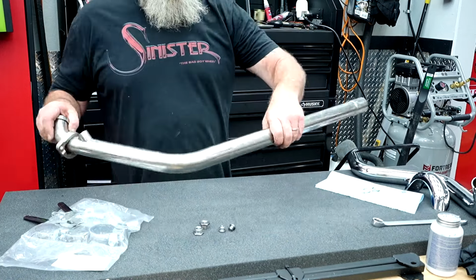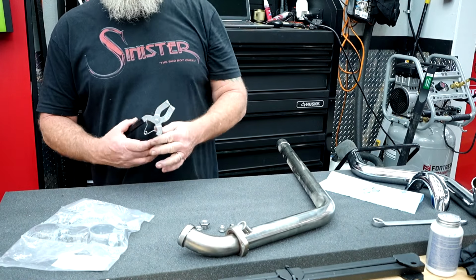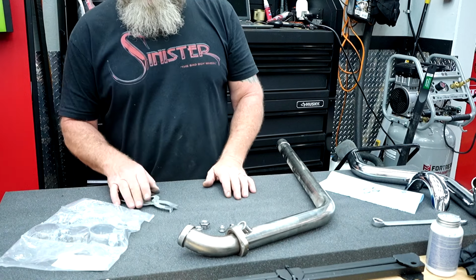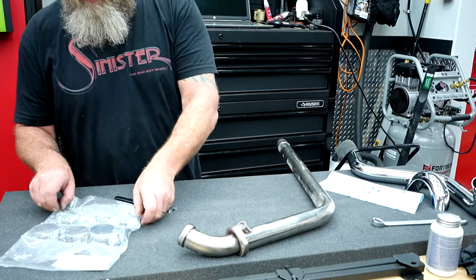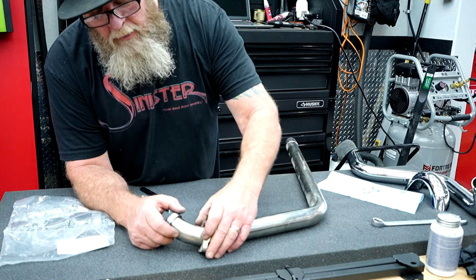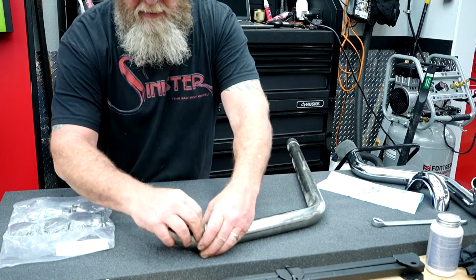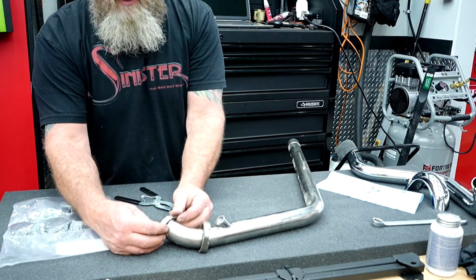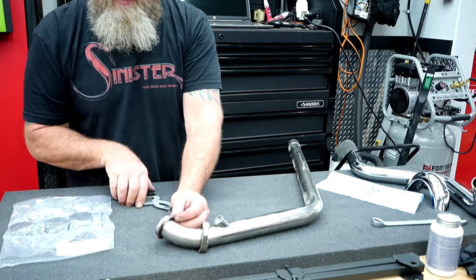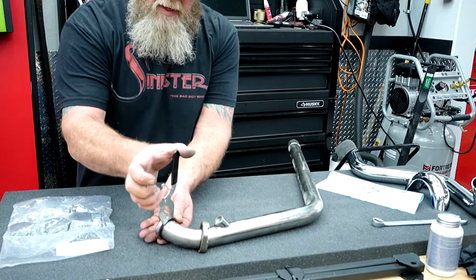We're gonna get the old pipe up here real quick. And you can take a flathead screwdriver and do this, or just get these kind of pliers like this. They work super handy for pulling this little ring off right here. It's like a piston ring pliers. You can pick those up cheap on Amazon. Now you can get this off and take the chance of bending it, or just use these. They're pretty cheap. I'll put a link down in the description down below.